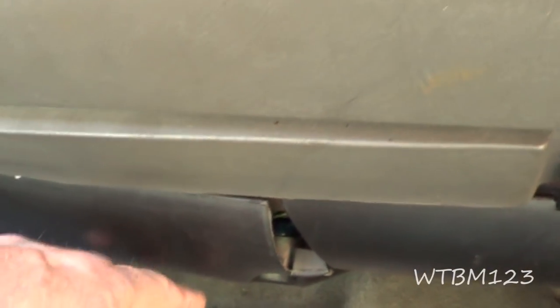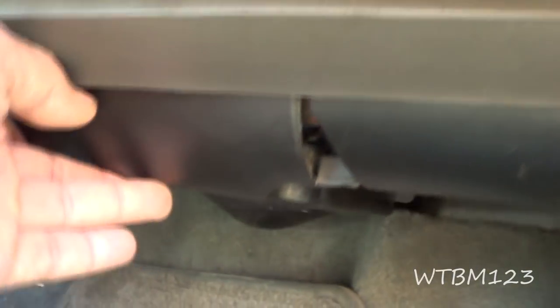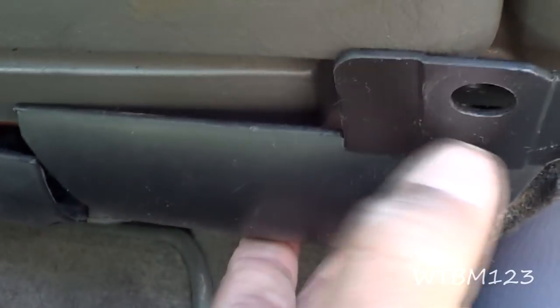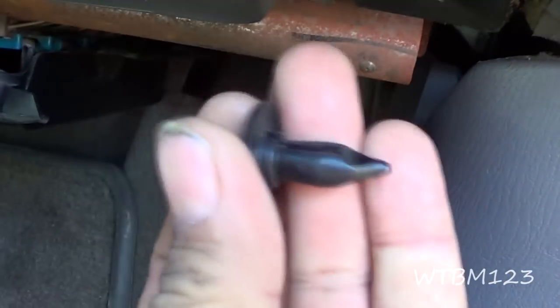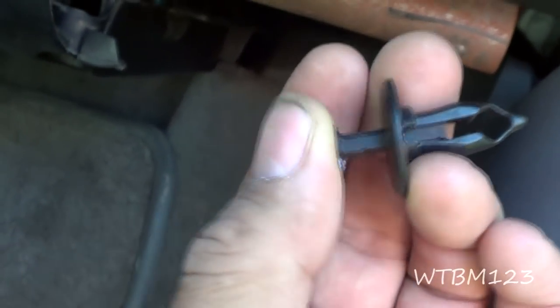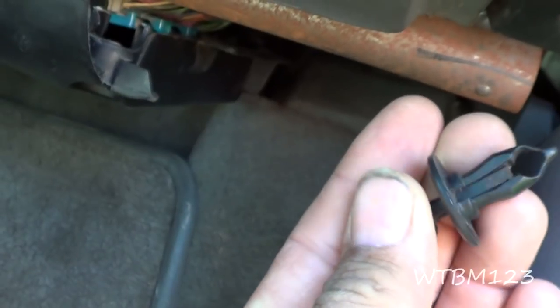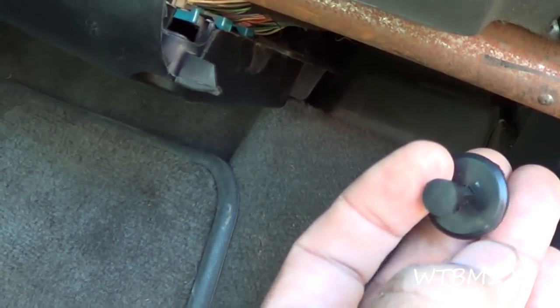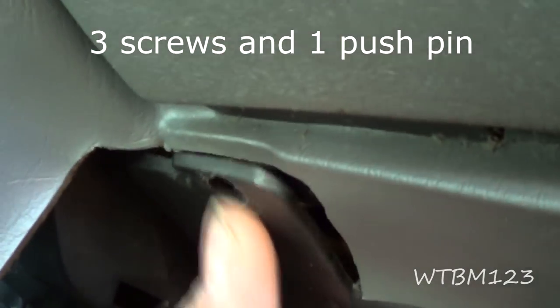What I'm going to do is, there's a switch up underneath here, under the bottom of the dash, and you can take this stuff out and get to it. Down here on the bottom, this first bit comes out, and right here is a push pin. When you push this in, it makes the bottom expand and it won't come out of the hole. To get these out, you just simply pull the center out. Then there's one right here, and there's a bolt up here.